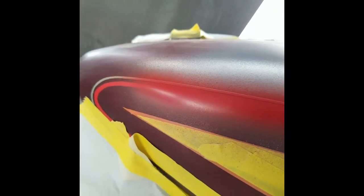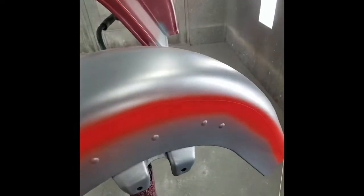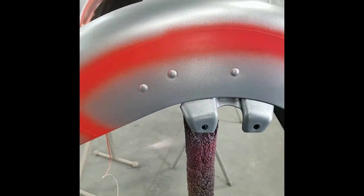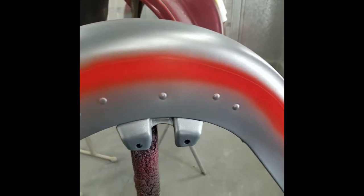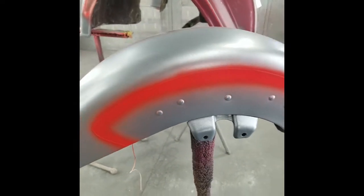There'll be a double pinstripe inside the tour pack lid. On the tank I blended the stripe into the original stripe — you can see the color matches well. Underneath the 1/16-inch silver stripe, that will be retained throughout the process until we get the luxury rich red done. I'll lay the eighth-inch fine line tape. Actually first I'll put a guide in between on most parts to give me the correct spacing before I put the tape over the orange-red stripe — I'll show you that guide again.